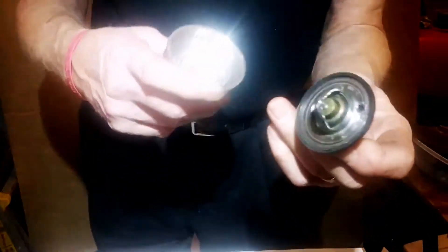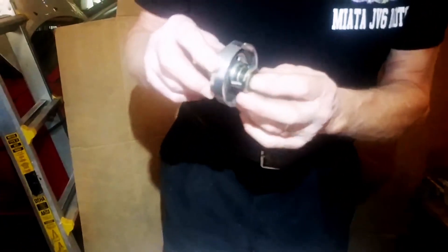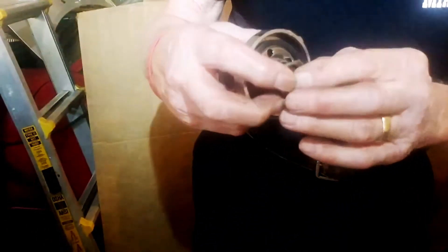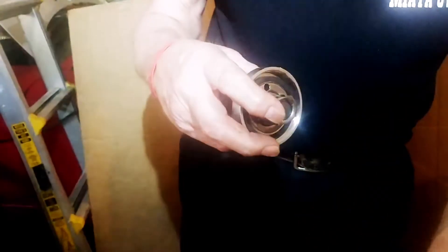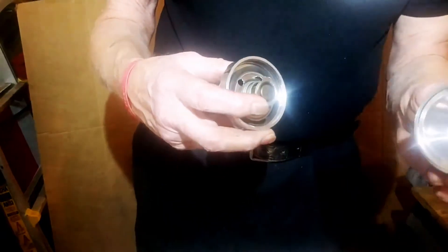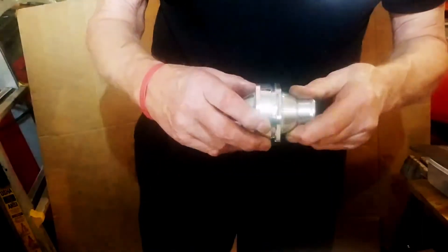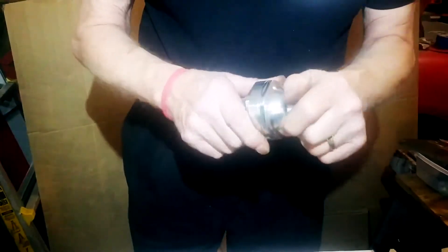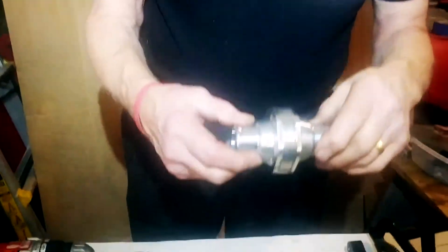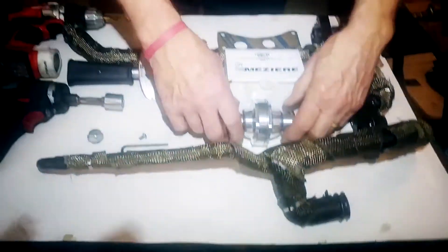We've drilled a hole in here, in the top. You want to put this hole in the top — configure it so it's at the top of the holes coming out, in order to vent, because you'll have air going through there and it'll vent that way. If you put it on the bottom, it won't vent properly. You also want to put some never-seize on these threads in case you have to take it apart and change the thermostat. I put a mark here where the top would be — just mark it in some fashion so you know where it is. The hole's up on top here.